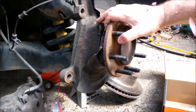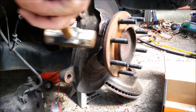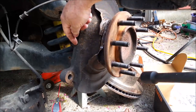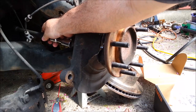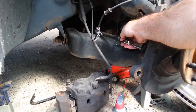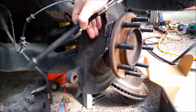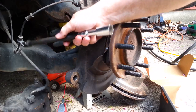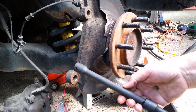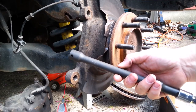The driver's side came off a lot easier than this side. This side I can't get it to budge. I've done a whole lot of hammering, a lot of prying. I even put a fastener in the back of it and put the socket on it and jammed a longer extension up against the frame. Then when you start the truck and use the power steering to turn the assembly and push on the head of the bolt — I couldn't get it to break free with that. I actually think I've bent the extension; it had about a quarter inch curve in it. So I had to give up on that.